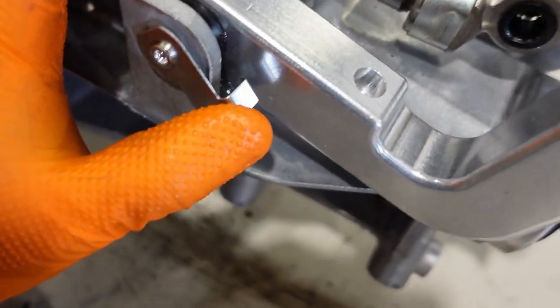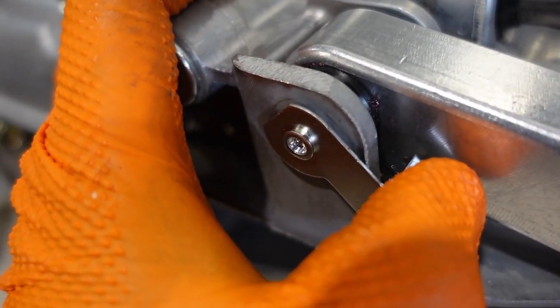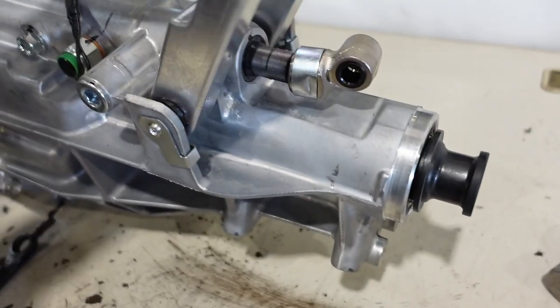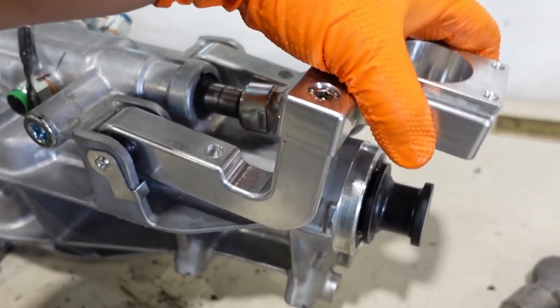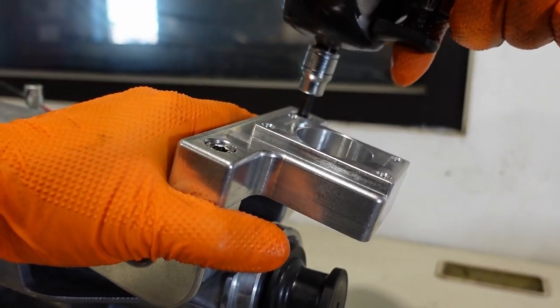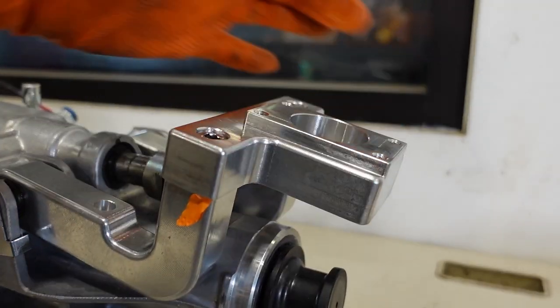This is a good visual reference of the back side of that shifter pin bore — it has to line up with another part of the transmission case, so having the ability to move and tweak things on the shifter bracket helps a lot. Once those are in place, the bushing should not be under any load. You should be able to rotate the shifter base pins until you hear an audible click — once clicked, they're locked in place. Re-tighten those two six-millimeter Allen bolts and give the shifter base a few light ugga-duggas with a 3/8-inch impact gun.